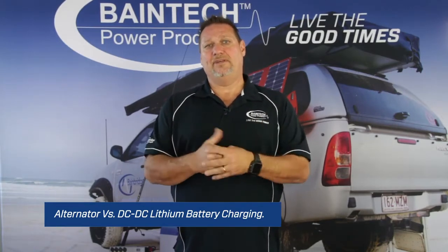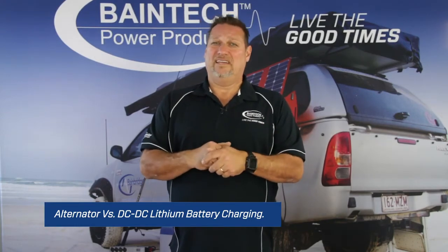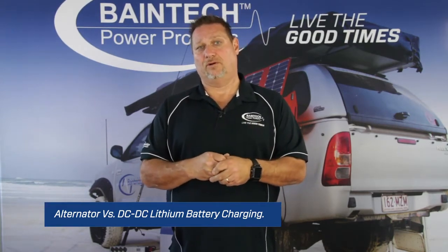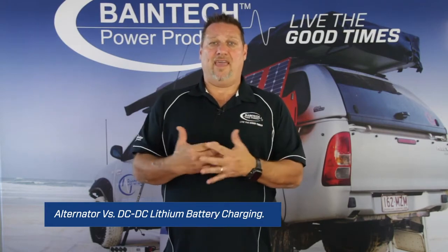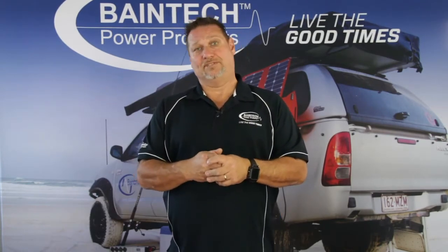So yes, you can charge a lithium battery from an alternator. However, we don't really suggest doing it, for the simple reason of how much stress and load it puts onto your alternator. A lithium battery with very little resistance in line will take whatever amps you've got available left in your alternator or charging circuit.